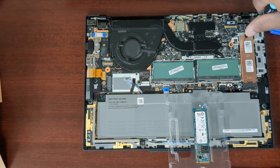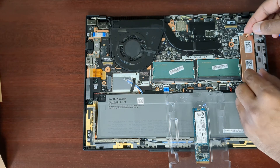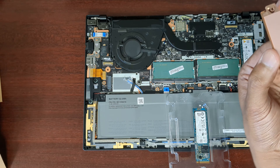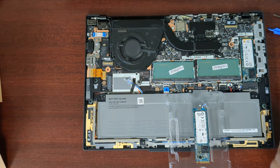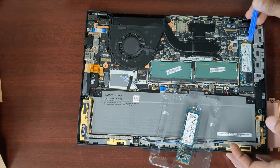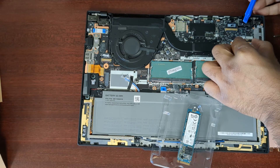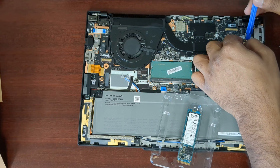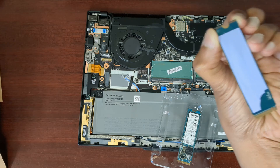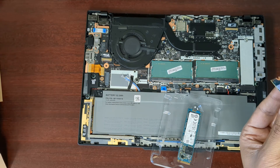For the SSD, it's just this here — one screw. The shield has that heat sink silicone rubber thing they always put on there, and the SSD comes right out. It might have that same silicone stuff on the bottom — and it does. Mine's missing a corner and it's not in the laptop, but anyway I'll just put my new one back in. I can peel that off and put it on the other one if I want to.